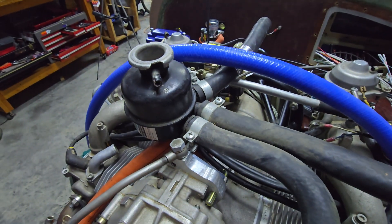I found on one of the Europa forum posts the various lengths of these hoses that come off the airplane — your mileage may vary, but it gives you an idea of those lengths. The top runs are there, and going down there are the bottom ones off of the pump. I also bought some heat sleeve to go on the ones close to the exhaust. There's no length for the bent hose because it was predetermined with that kit, so I'll use the same straight hose with a Goodyear spring to keep it from kinking, going from this port around to the back.